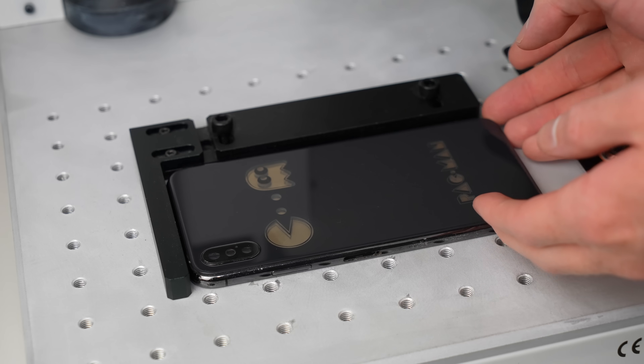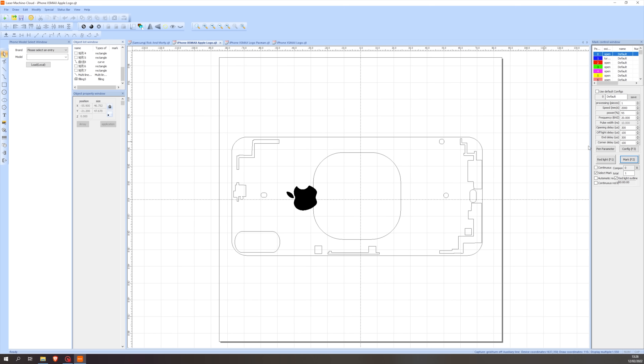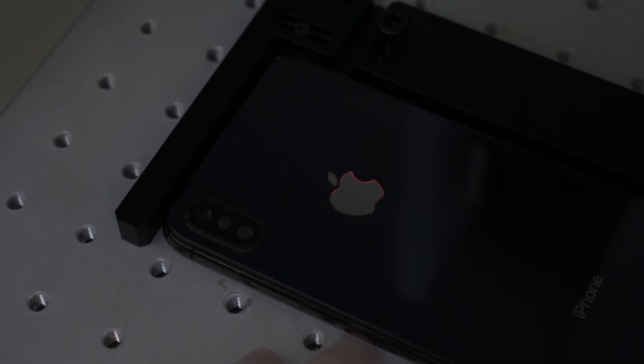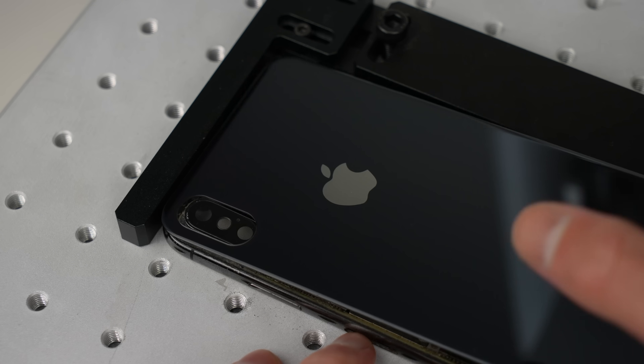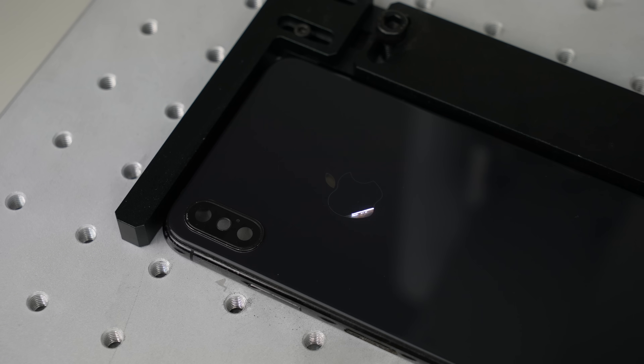These graphics had to be slightly modified in Adobe Illustrator to work with the laser. The next design is the original but with a twist — I will trace out the Apple logo in the exact same position as on an original housing. Then I can swap over to a blank panel where we can burn in the design. What we end up with is a transparent Apple logo — a logo we can put any color behind.